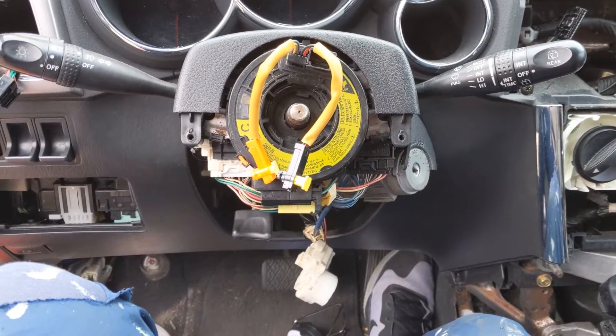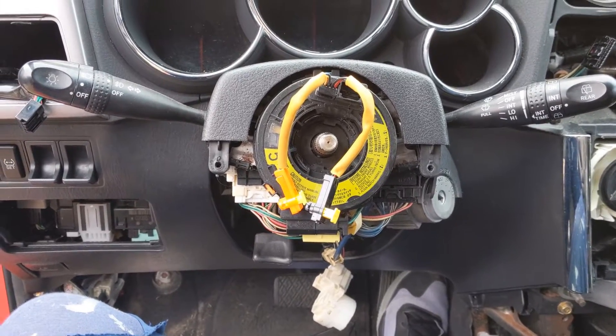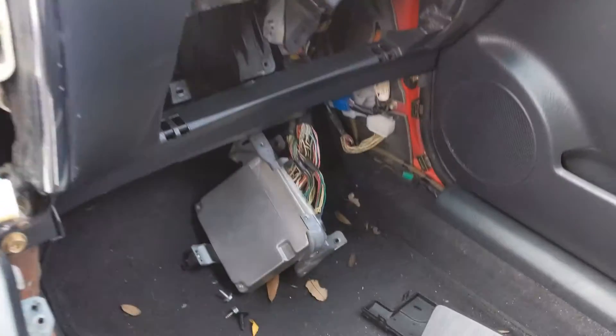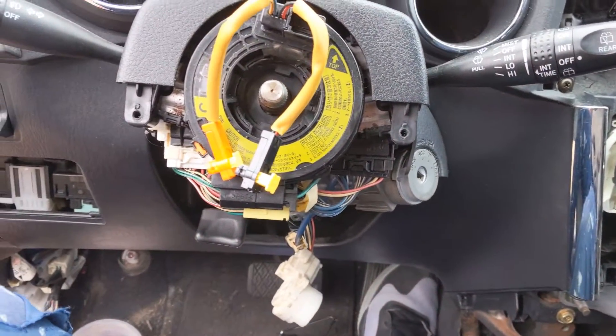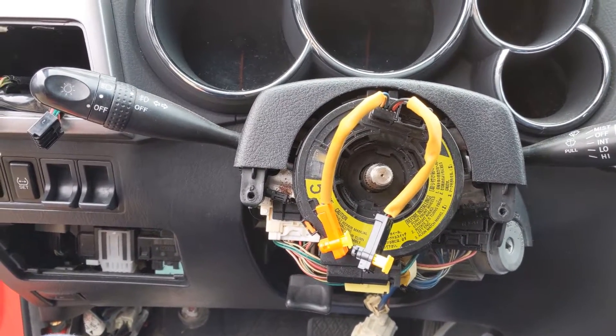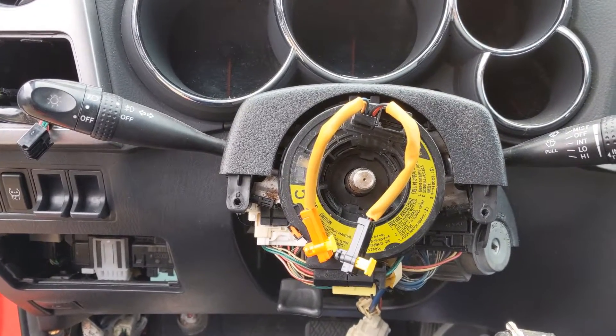Since I don't have the key for this car, I essentially bypassed the ignition. I did not have a crank, so I went through all the fuses. I even pulled the ECU — I was about to swap it. But it was weird because the check engine light wasn't coming on initially, and without the check engine light coming on when you first turn the ignition, it usually means the ECU is not powered up.